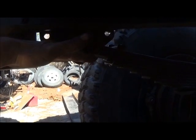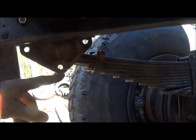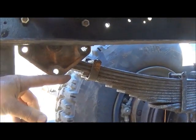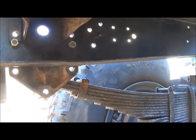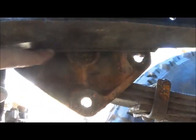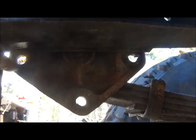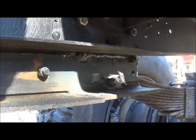We'll weld it in here — I'd like to get a couple bolts in it so it's bolted to this, then weld it to the bottom flange, bring it back. That'll leave room for maybe a couple small pieces coming off of it up to the original crossmember. We'll decide that after we get them on. I'll go ahead and get them cut out, get the holes drilled, get them bolted on. We're gonna move this enough to get some weld on this back plate — there's the frame and then there's a plate, but I don't mind welding to it.